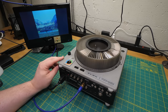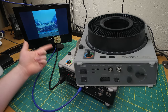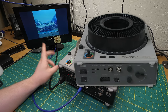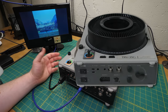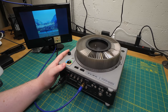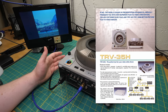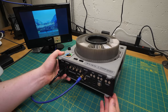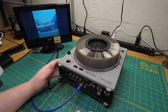The 35G's only real changes over the original were the addition of BNC connectors and a Genlock input — there's no RGB, no S-video, and the camera controls are still manual. It also lacks computer control, probably because Elmo weren't yet selling video mixers. So the 35H is a massive leap in capabilities over those models, but it's also quite a bit newer. The oldest references I can find are brochures from about 1998 — they've got website URLs. By '98, RGB video processors and computer-controlled mixers were far more accessible even to prosumers, and the interfaces were much cheaper to add, so it made more sense to just put it all in just in case anybody wanted it.